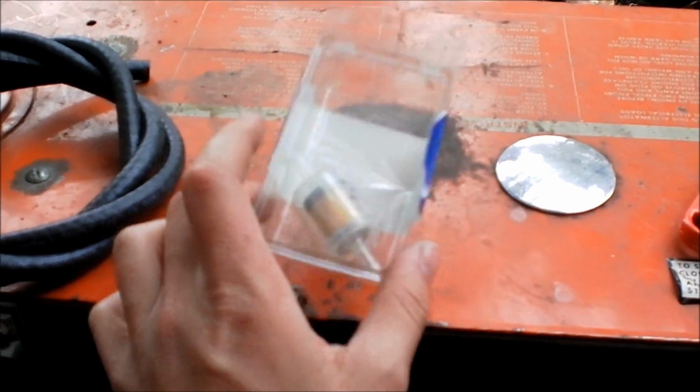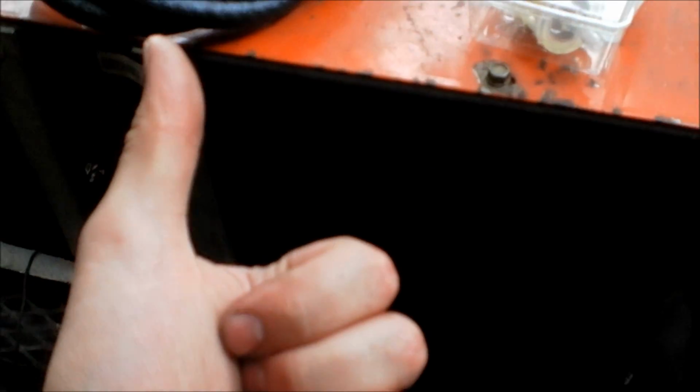That is pretty free. It wasn't free earlier. I sprayed it with carb cleaner, so I guess I did technically touch the carburetor before, but all I did was free the throttle up. So let's see what happens. I'm going to go ahead and get some fuel line on it here and get the fuel filter in between. See you in a second, tubers.